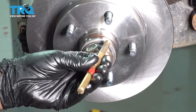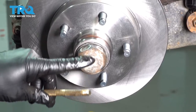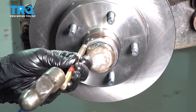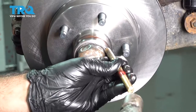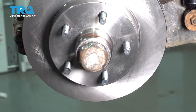Use a brass punch on the perimeter — you don't want to smash the end with a hammer or mallet because you can flatten it out, and that's going to contact the cotter pin on the inside and possibly make noises. Work your way around and seat the cap.